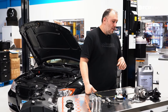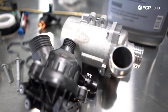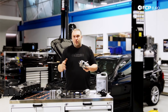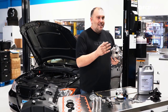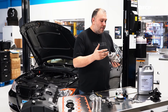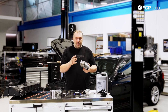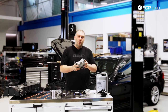Last but not least, let's talk about the cooling system. The Achilles heel on this engine is the water pump — it's an electric water pump that basically looks like a little turbocharger, physically bolted to the side of the engine block. It's an external water pump, so no serpentine belt drives it — it's all electric power. One unique thing about this system is it has different modes of operation. BMW looking to achieve maximum efficiency, this water pump can actually change the tolerances of the engine through its cooling cycle: running cooler gives tighter tolerances and a bit more power; running hotter opens tolerances for a bit more fuel economy.